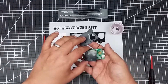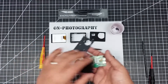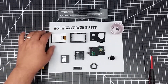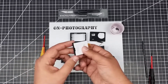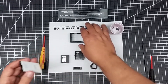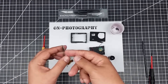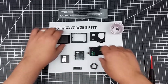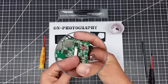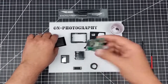Typically your battery compartment will sit on top sort of like this, and this unit will sort of come up. One of the pieces is that this is also attached to the screen in the back. The way this comes apart is it has almost like a plastic coating — this is your screen here and this is the bezel — and it's just glued into the back and sits on tabs. All you need to do is take the X-Acto knife, work around a corner, pry it up, and it'll pop out. Then you simply move the clip up with the screwdriver and the ribbon cable will pull out, and this whole assembly will lift out.